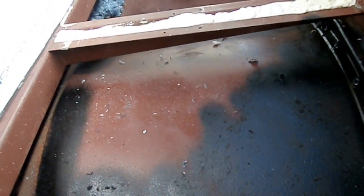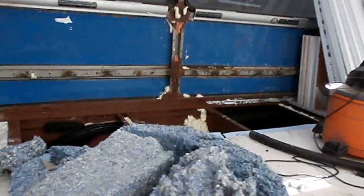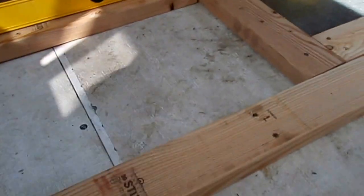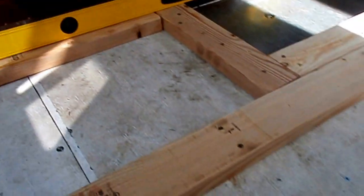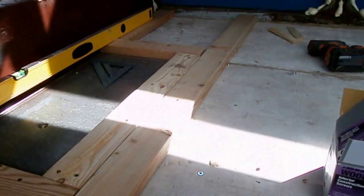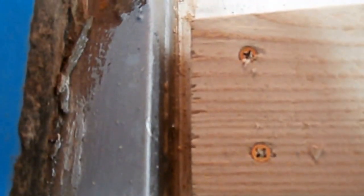will go in here, and I'll put this piece on top and put that piece on top, and then I'll continue on the second layer of flooring, which we can see here. We have the second layer. So what this is going to be, we've got the 2x4 studs that will span the width of the bus. Of course, we're going to leave that gap there.